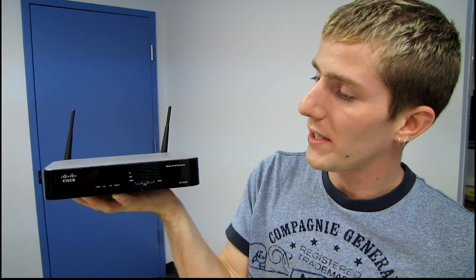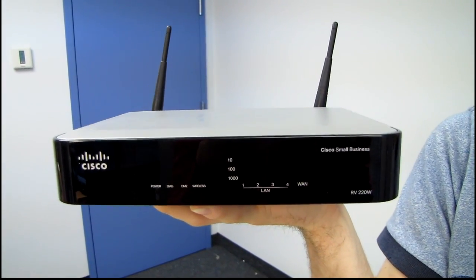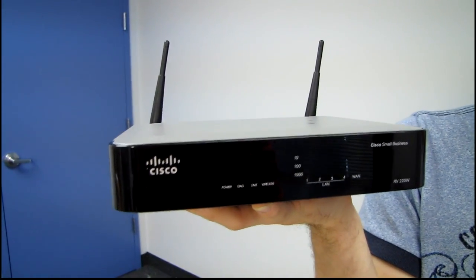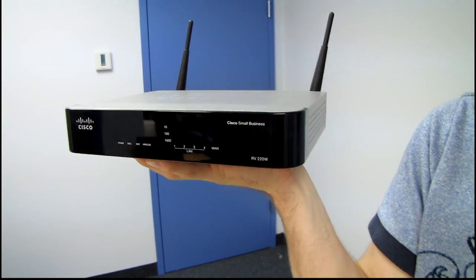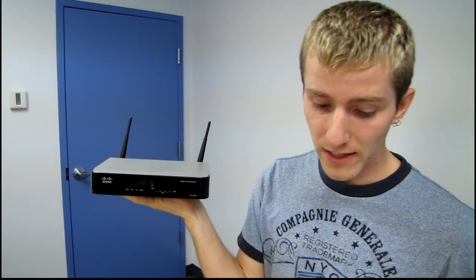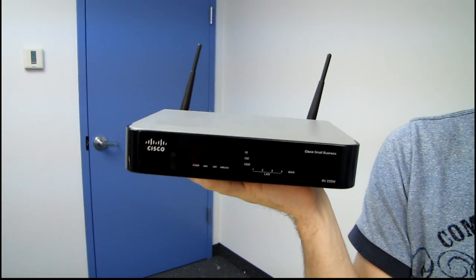Let's talk about some of the other features that make it neat. The RV220W is all about security and reliability — you do not want downtime. Between the Cisco forum, which is an online support community for small businesses to connect with other Cisco customers and partners, and direct support from Cisco, you're well covered. Compared to its little brother, you have the same security features including hybrid VPN with SSL and IPSec capabilities, but more so — where the RV110W supports only five IPSec connections, this supports 25. It also has a limited lifetime warranty, whereas its little brother, at about a third of the price, only has a three-year warranty — though most consumer routers only come with one-year warranties.